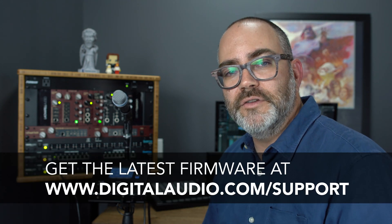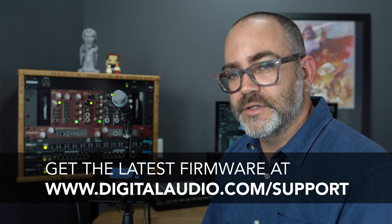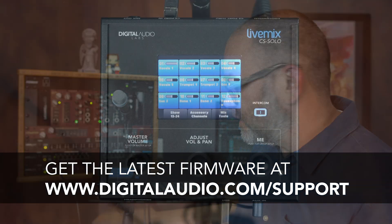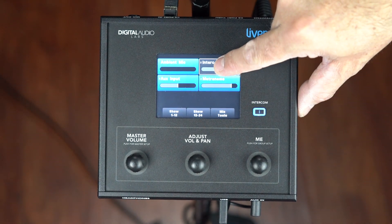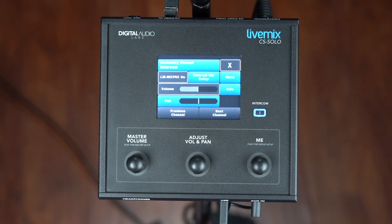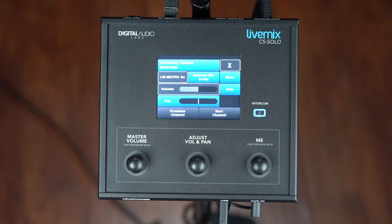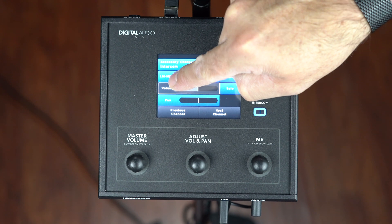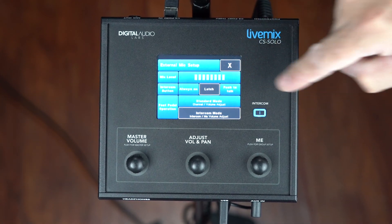Now that we've got all the connections set up, let's look at the inside and see how to set up on the personal mixer itself. First, a note: if you don't have the latest firmware you're going to need to get that — this latest firmware is what allows the LM Mic Pre to work how it does. So we're going to go to accessory channels, and on the intercom we're going to long press and it'll bring up a single channel view for the intercom. There'll be a new button here with this firmware that says LM Mic Pre on or off. We'll just turn it on and that will engage the external mic setup.